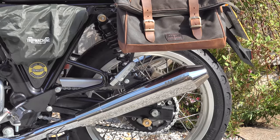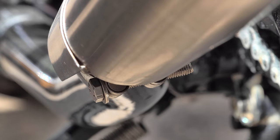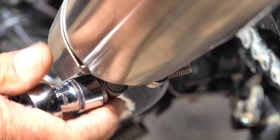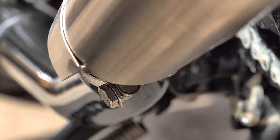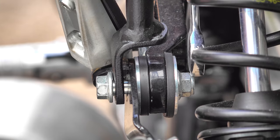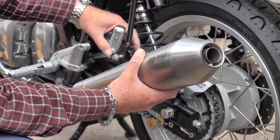Let's have a look at what it takes to fit these silencers. What a breath of fresh air working on the Interceptor after working on the exhaust systems on two water-cooled Triumphs — this is how a bike should be. Instead of messing around with a plethora of angled pipes and unions that are hard to get at and relatively unstable when finished, there are basically just two fasteners to deal with to remove the existing silencers: a conventional union clamp at the front, and then one other bolt that holds the exhaust onto the mounting bracket. Once those are both unfastened you can gently wriggle the silencer free.